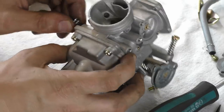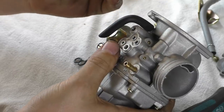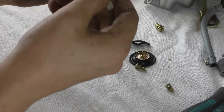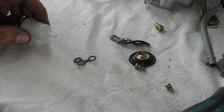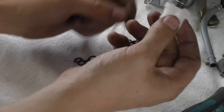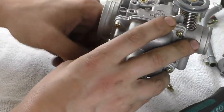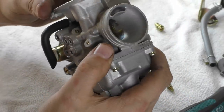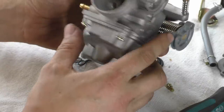We've got our check valve in there — quite sophisticated actually. The plunger has an O-ring on there that really isn't doing its job, and some of the plastic's bent back because of that clip. Right — the meat of her. This is our fuel inlet with the shittiest fuel filter. Has that actually got a filtering element in it or is it just plastic? We'll check that out. I do like the electro-polishing — look how shiny that is in there, it's amazing. Not really required, but amazing.